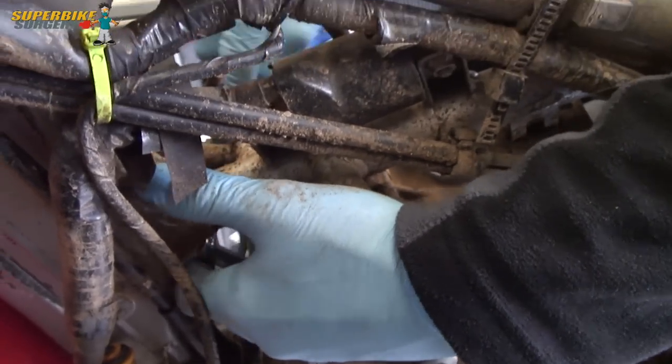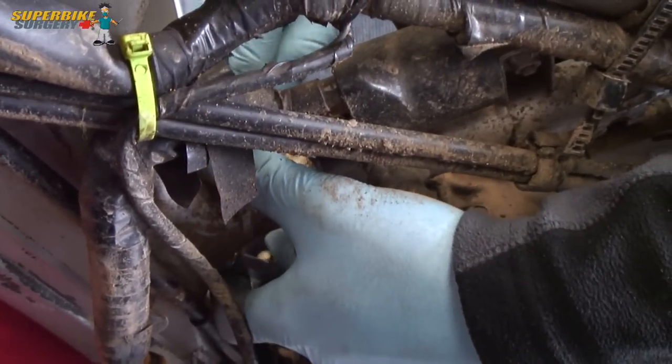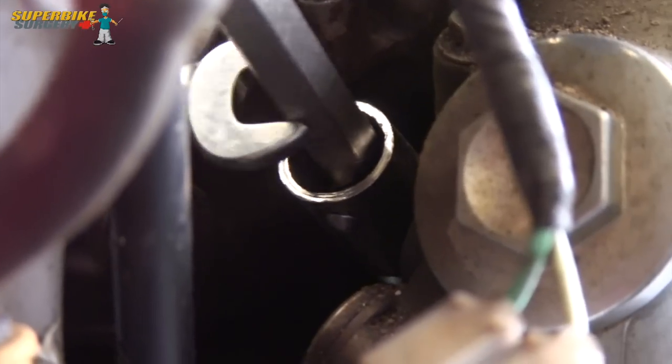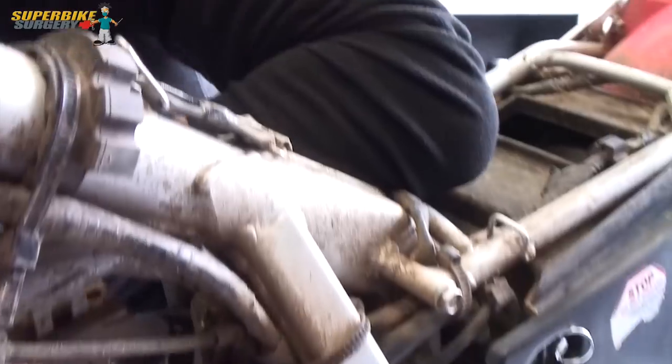So what are you using there? You're not using a ratchet? No, I'm just using the genuine Honda plug spanner because it's nice and narrow and it'll fit down in the tunnel where the spark plug is, just with a 10mm spanner on the end of it. The good news is it hasn't snapped off and it's come all the way out. The last three or four turns were fairly free, so I'm hoping it might be okay.